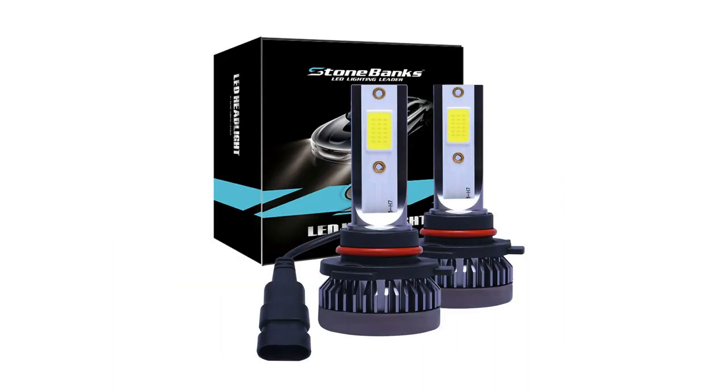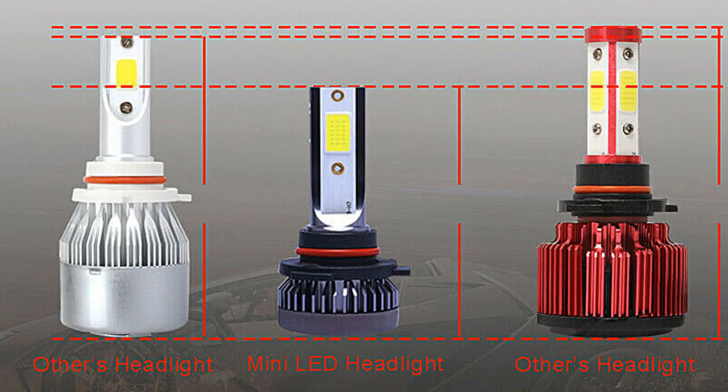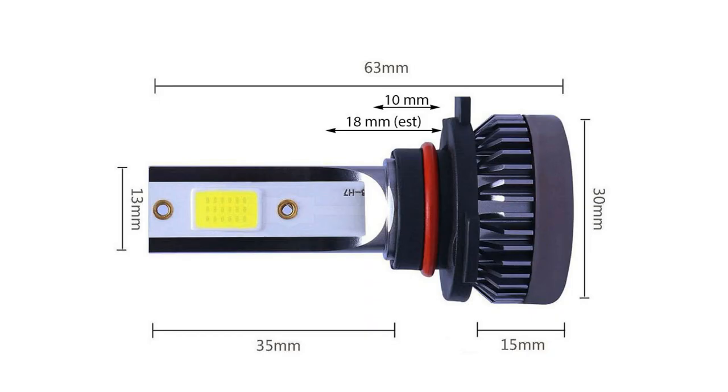While still considering the GTR Lighting lamp I found one on eBay — the search term is 'mini LED headlight 9005 flange.' Checking dimensions, this lamp should fit, albeit with a few small modifications: the black flange needs a little filing, the o-ring needs changing or supplementing with one large enough to provide sealing and keep the lamp from rattling, and a harness is needed to transition between the car's connector and the lamp's connector.